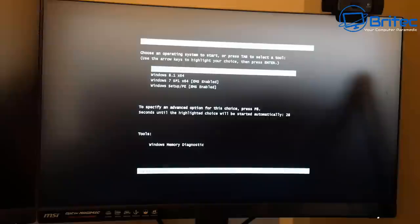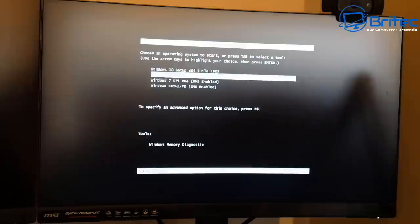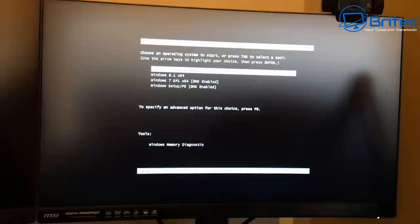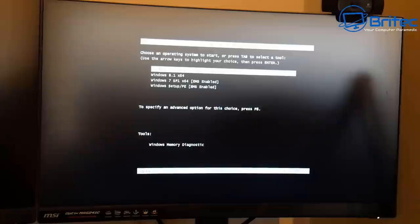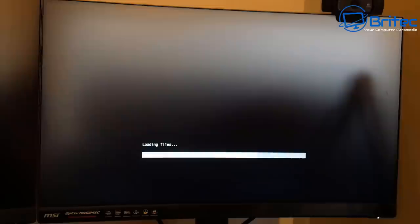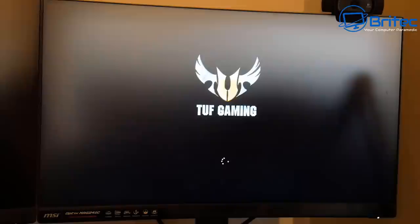Booting up for the first time on a PC. Because we're in UEFI mode, we're only getting Windows 10, Windows 8, and Windows 7 and the PE version — not the Grub for DOS screen. That's because we haven't got legacy mode enabled; we're in UEFI. If I put legacy mode on, you should be able to see all of that booting correctly. These options still work though — you can push them and they'll load.